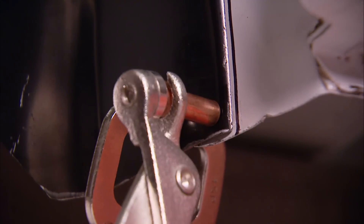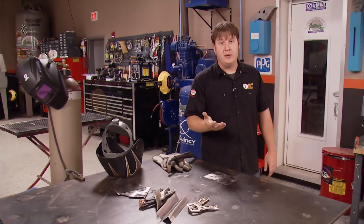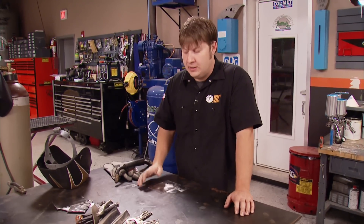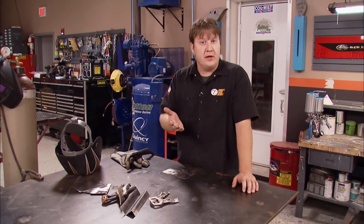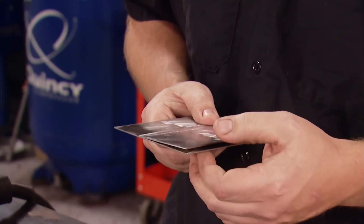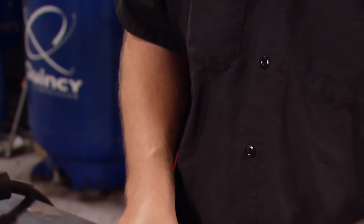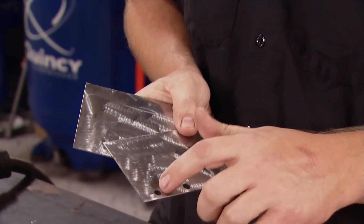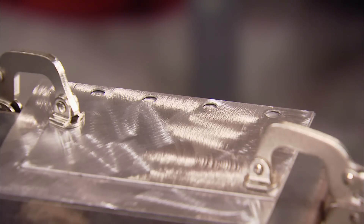A few clecos and she'll sit tight while Tommy shows you how we'll weld them up. With the clecos holding the tubs in place, it's time to burn them in. The way we plan on doing that is with some plug welds, also known as rosette welds. This type of welding is used a lot by auto body rebuilders because it's very similar to the way OEM manufacturers put the car together. When these cars are put together at the factory, the manufacturers have spot welders which use two electrodes to pinch together and heat two pieces that are fusing. In the repair industry, what's commonly done is to drill a hole in one of the two pieces, then use a MIG welder to place a weld that holds the two of them together. Let's take a look at how these welds should look when they're done.